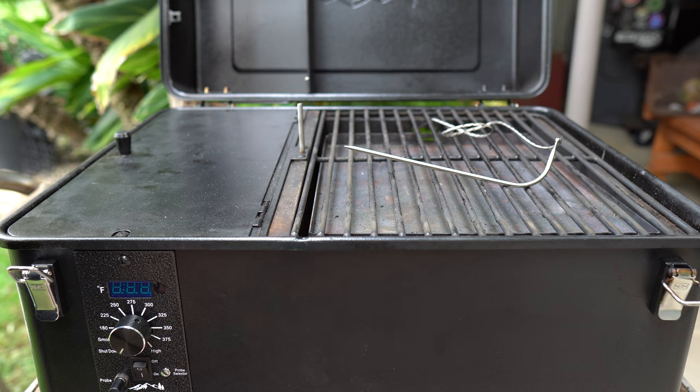Before you get started on this job, practice basic electrical safety — make sure that the Traeger is unplugged whenever you're working on it, and make sure all your wires are nice and tight and snug before plugging it back in. Now, Traeger customer service indicated to me I had an older manual which said to keep the lid closed during startup — well, that's wrong. Tech support corrected me: for the first two minutes of the smoke setting, you leave it open. So what we're going to do right now is go to the smoke setting for two minutes.